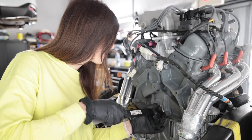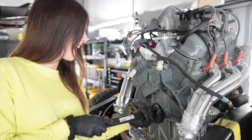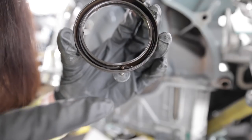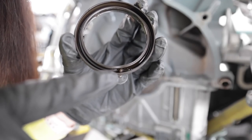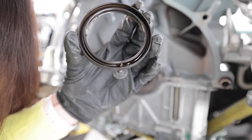It's starting to pull — it's starting to pull it out. It's out. See right here on the backside: the screw poked through in between the two lips. That's what you want to happen. You don't want it to go into either one of those, because then you're going to scratch up either the crank or the wall.